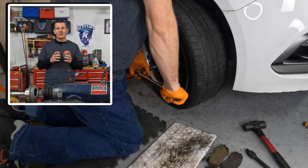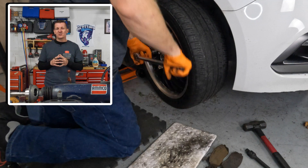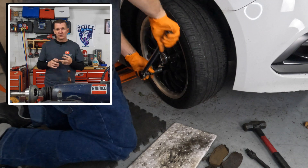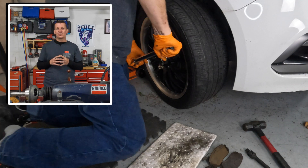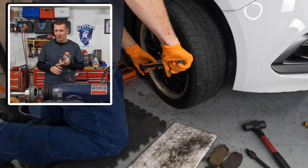Now, if you're working on a 2018 to 2021 Hyundai Sonata, these lug nuts are tightened down a little bit tighter. The window on these lug nuts is 79 to 94 foot-pounds, so just make sure you're tightening them up properly in a good cross or star pattern — not in a circle pattern. Again, the 2018 to 2021 year models: 79 to 94 foot-pounds.